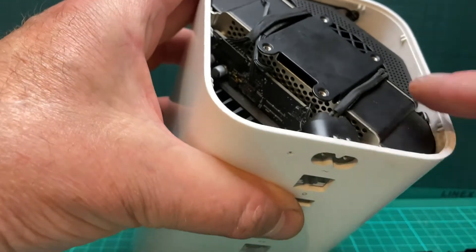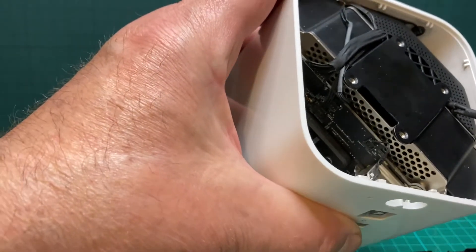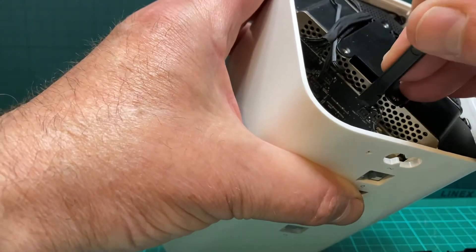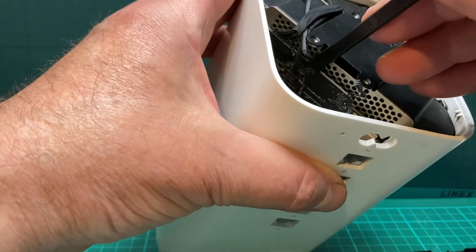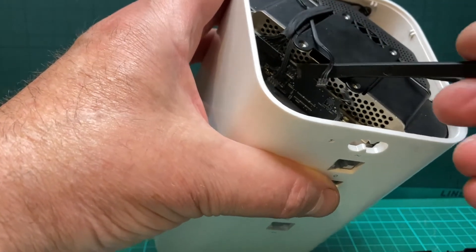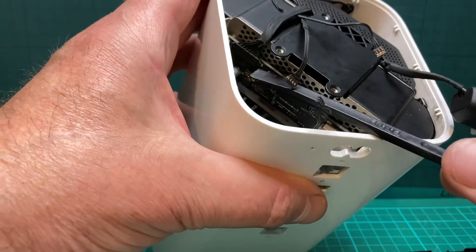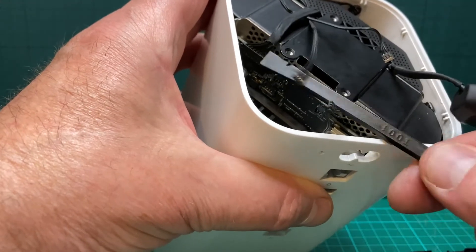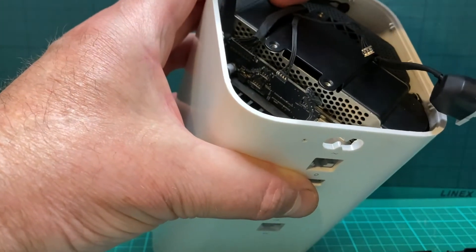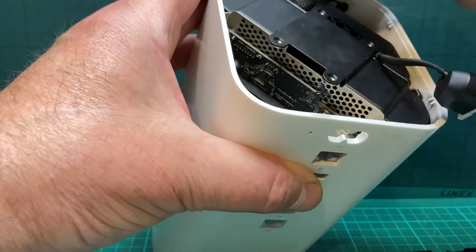There you have your insides. T8s — remove the four of those. Before you remove the plate, just undo the little tabs and you can remove the power supply — just pull it up and out of the way. Then you'll see the little connectors in here. With a plastic spatula, just go in behind them and gently prise them out — that's one, two, three.